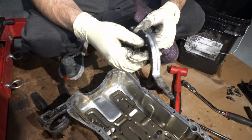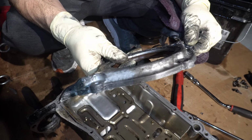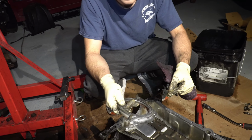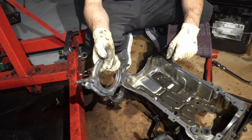This is the old rear main. Little crusty looking, little dry rotted. She's seen better days, but that's alright. When we do swap, from my experience, and if the transmission is off, how much was that? $49. Was it that much? Okay. But anyway, isn't it a good idea to do it anyway? Imagine changing that: what do you have to do? Take off the transmission, because that's behind the transmission, and you just can't get to it.